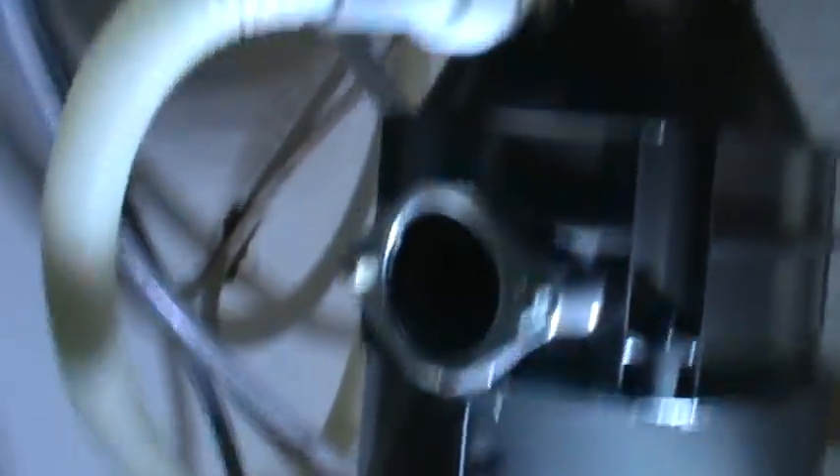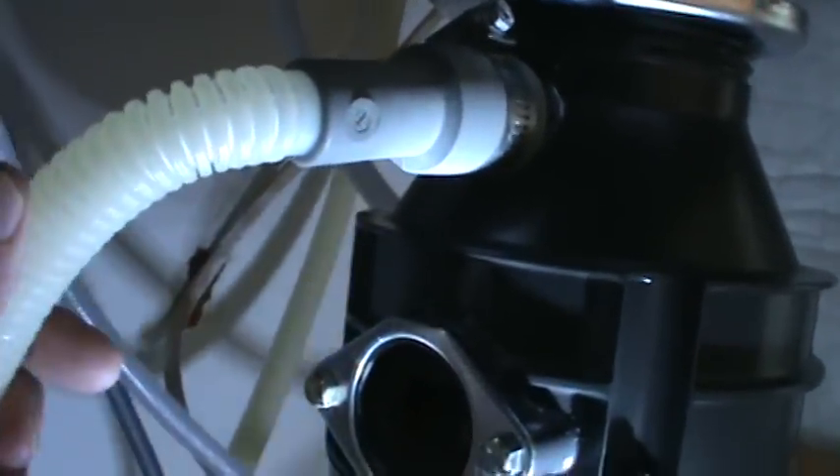The garbage disposal actually worked okay, but because of the pressure that built up, it ended up leaking at the bottom — and it had never leaked before. It was leaking right out of that reset button. So what we have to do: we don't have to disconnect the drain pipe because it's already out. This tube goes to the dishwasher, so we'll just unscrew that screw and loosen it a little to take it off. I've got something down here to catch the water, and then we'll take the electrical connection off — which is exactly why I've got the breaker box turned off.